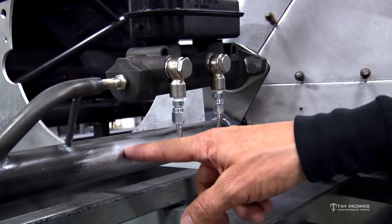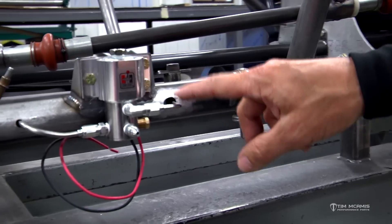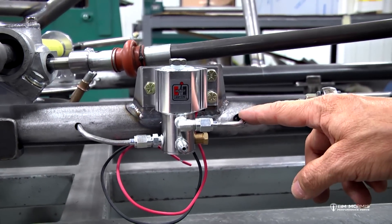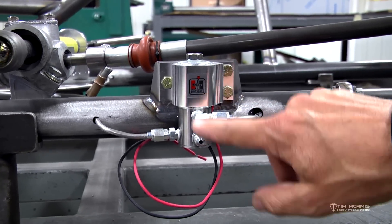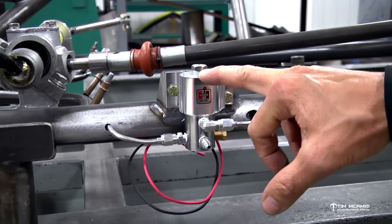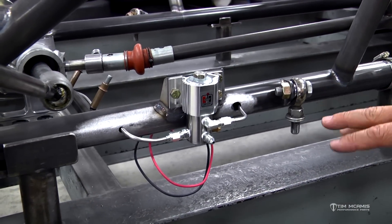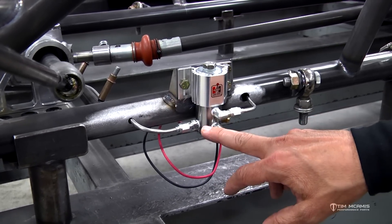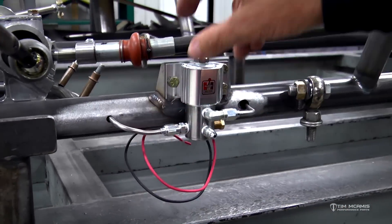This brake line goes in and then it goes forward — coming down inside this tube, popping out here. We've got our line lock right here, same thing with a conduit here. We're going to come out of here and bend this and stick it right into that little port marked 'M' from the master cylinder. Then we're going to use this line lock as our junction block for the left front wheel, continuing out of this side. These three ports on the bottom are common.